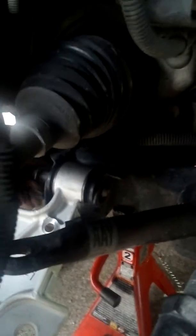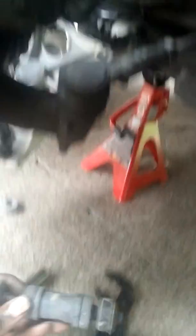That's the second connection there. Sticking that bolt in there, it goes right in pretty much. When you put the nut on there though, the nut only is going to spin a half turn, so you have to spin it from the bolt end. I did find that other set of bushings — it rolled up under the car. That's what that looks like — stabilizer bushing — and it goes right in here, just a set of rubber bushings. Put these four bolts back in here, grease the fitting — the lower control arm fitting down here — and grease that. Put the Zerk fitting in already.